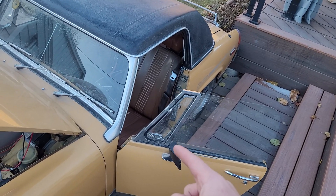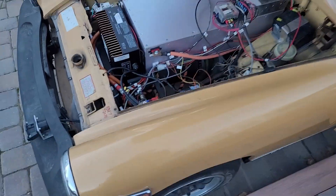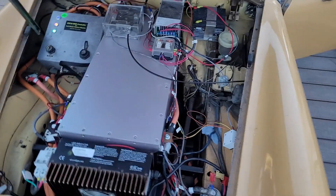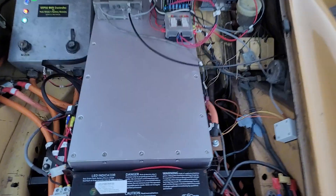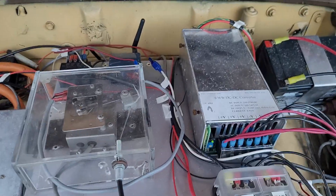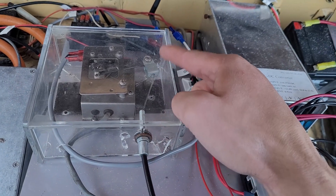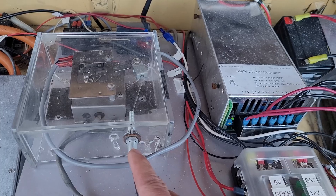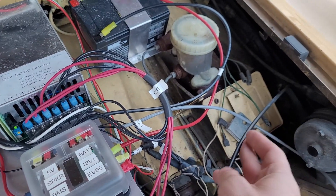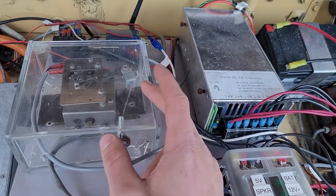Final update: I was going to park the car and was having trouble getting out of reverse. I put it in neutral, shut the car off and back on, and the motor started spinning right away — the throttle stuck. I came here and jiggled this cable and saw it return back all the way. That's something I need to fix — I don't want the throttle getting stuck. It's not safe.